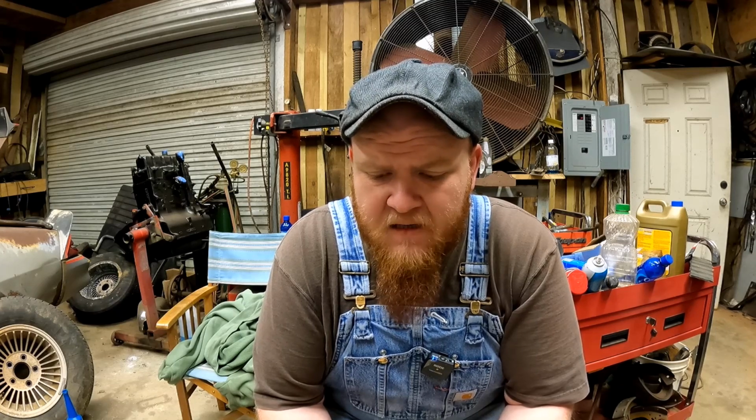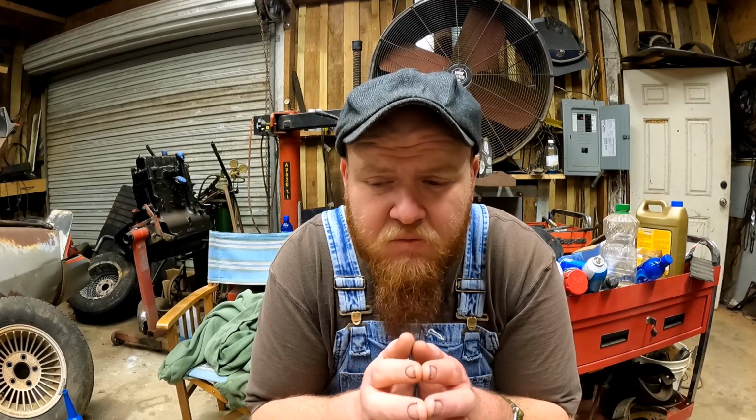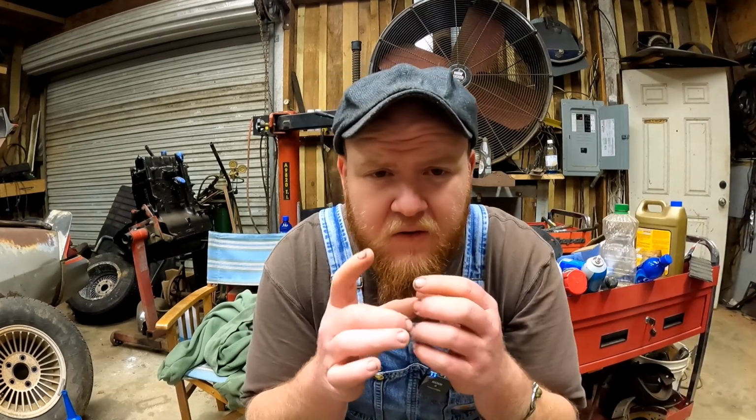I have cleaned the bottom end of the engine. I've got it almost done. Cleaned it pretty good, scraped it and stuff. There's still a little bit of the gasket left on it. But I was under the impression on the Willys engines that I've messed with, 4 cylinders, the L head and F head, and other rear main seals I messed with on older stuff, that the rear main seal is under the rear bearing cap.